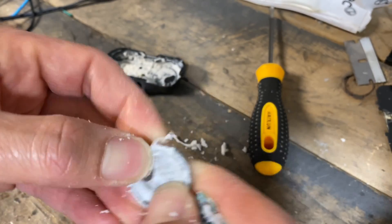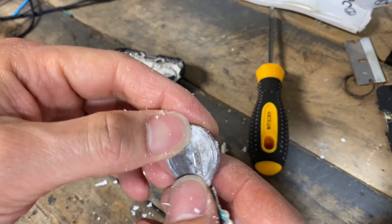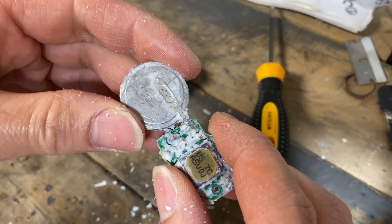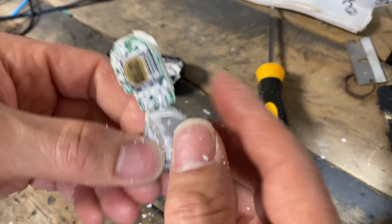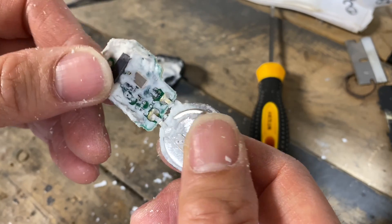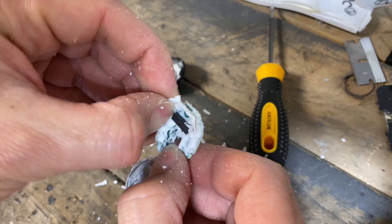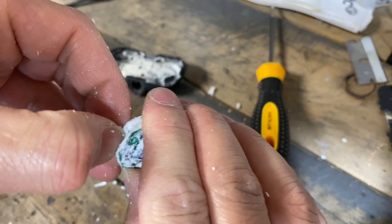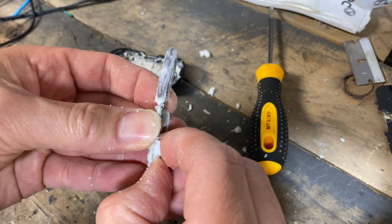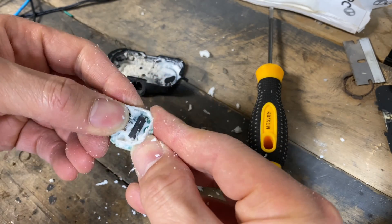Overall, to go through the trouble of replacing an $8 battery and then try to put it back together and hope it works - you might as well pay $35 or $45 each for new sensors from Denso. It's still an original Pacific brand sensor, but Denso markets it as their aftermarket replacement even though it's an OEM Pacific sensor. Check my links below for these on eBay or Amazon. You'll need to make sure you can program it, or have a tire shop or someone with Tech Stream do it. Most tire shops have the Bartec tool or the Autel tool to program sensors now - it's been over a decade since this was mandated, so all tire shops have it if they want to stay in business.